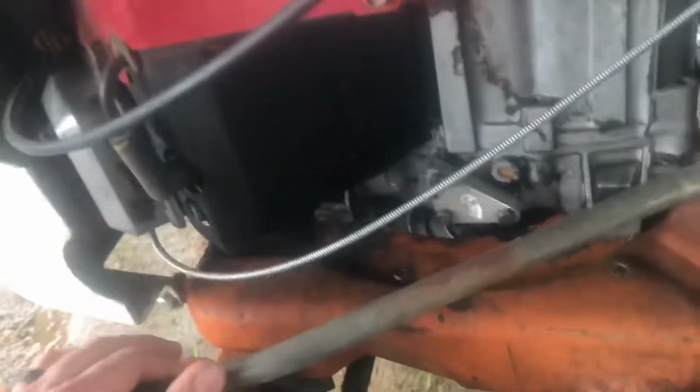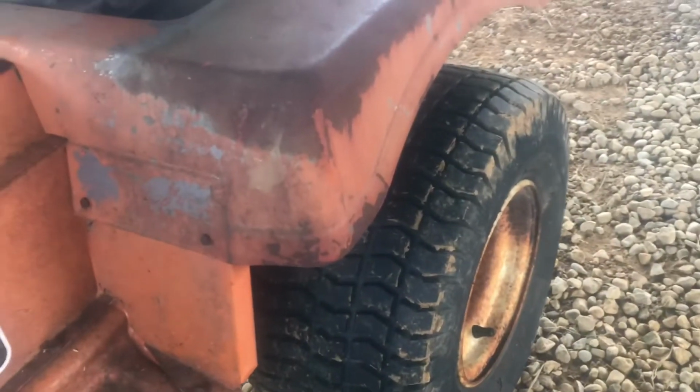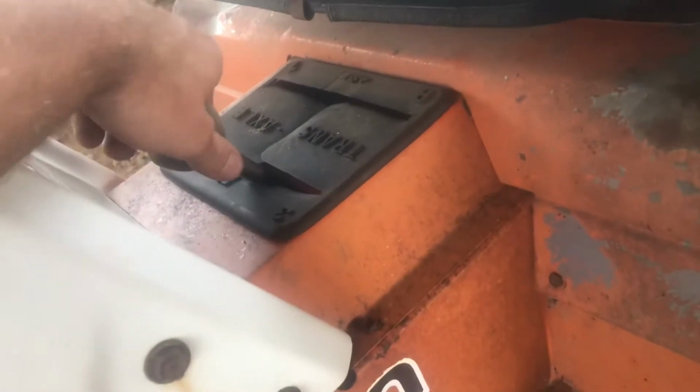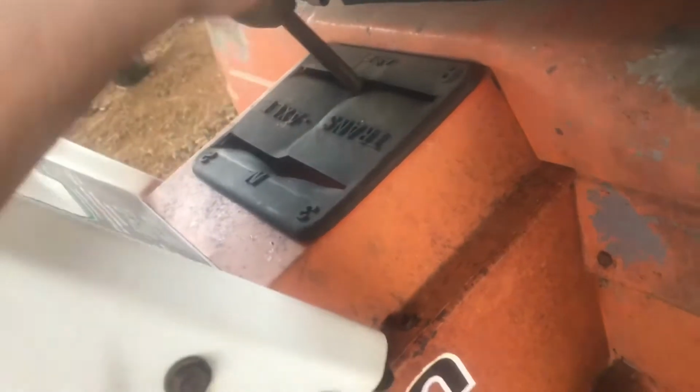So I have a 10-inch pulley on the front, 9-inch in the rear, which is actually way too fast. The Peerless 600s don't have much gear reduction in them. I kind of forgot that. So it's actually too quick for what I built it for, just by a hair, but it'll be perfect for the 820. But so far this is still working.